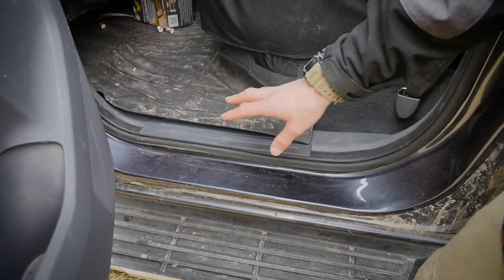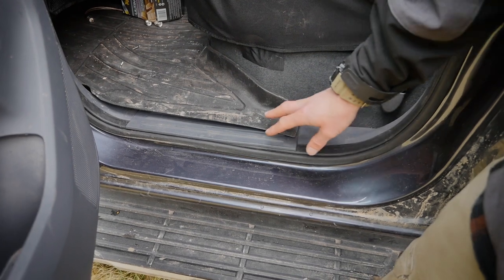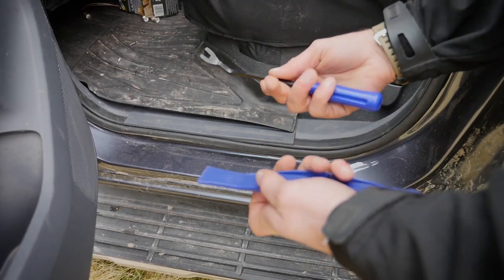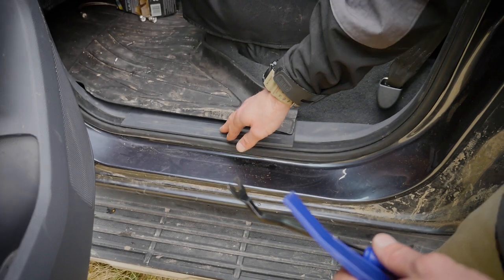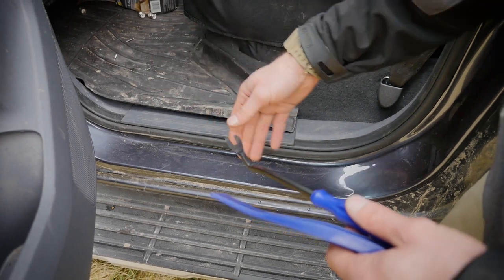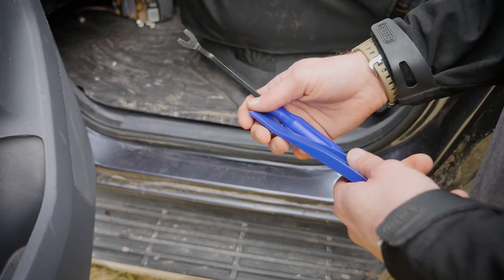All the power was put down basically the passenger side. In terms of getting the plastic trim off, you want interior trim tools — they make taking these plastic trims off quite easy and stop you from breaking any clips, because using a screwdriver ends up damaging all the plastic. They're quite cheap on eBay or Amazon and come in a large pack for a good price. All the cables have been basically routed through here, cable tied, so they're all nice and together and marked — I know exactly what cable does what, all the way through to the engine bay.